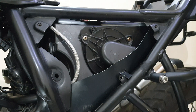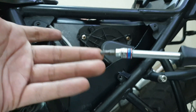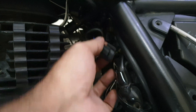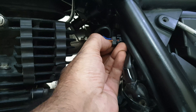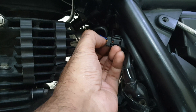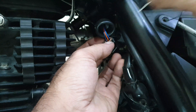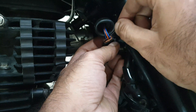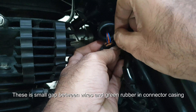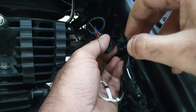So how do we check this? First of all, you will need a voltmeter and a T25 Torx screwdriver. Now what we need to do is understand the basic wiring: the black and blue one at the bottom is the negative, the constant red one is the power supply, and the top blue one is your sensor feed. You're going to take a needle and very carefully pry it close to the gap, making sure you can feel it rubbing against metal as you go in.